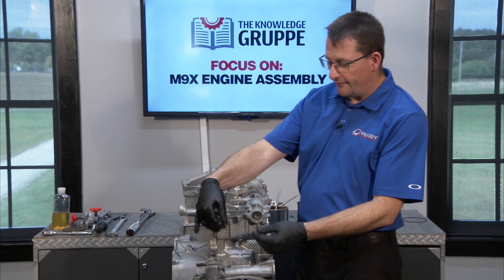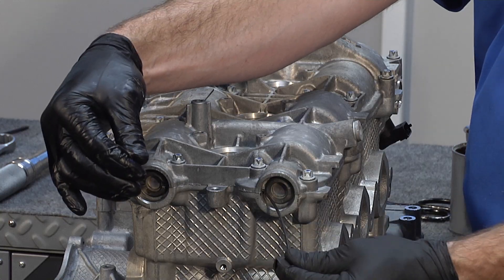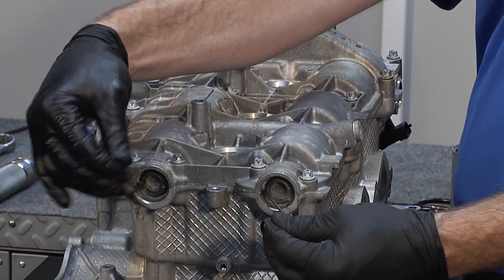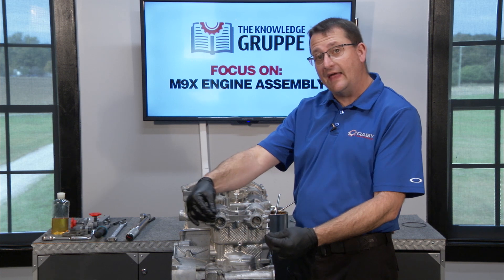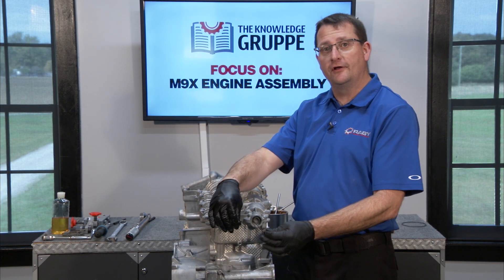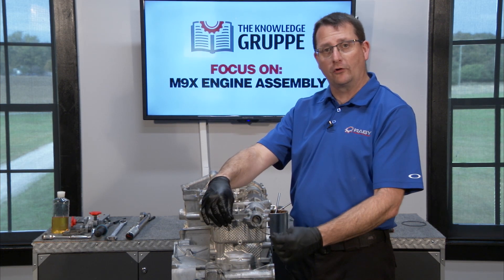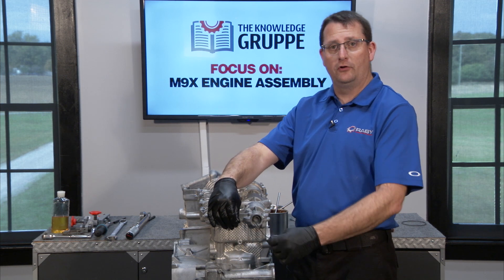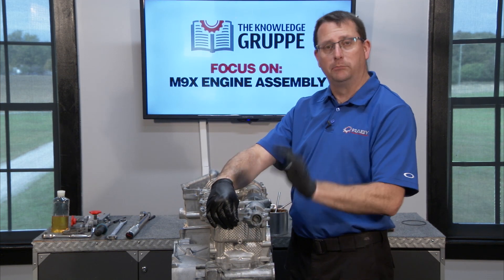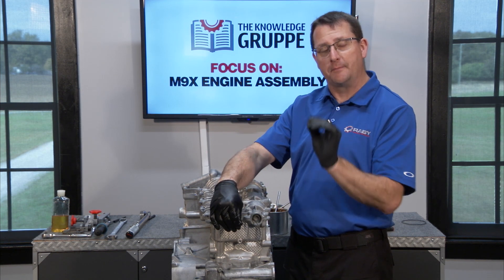This leaves us with the tools that we actually made from the cut-up old scavenge pump O-ring. If you did this properly and used enough grease, these will come out. You will have to tug on them pretty good because as you pull on them, they will actually shrink a little bit. And that's what makes them work so beautifully — as you pull, they shrink and they're able to pop out and leave that galley completely open with as much oil flow through it as absolutely possible.